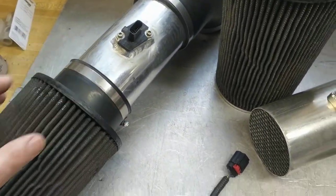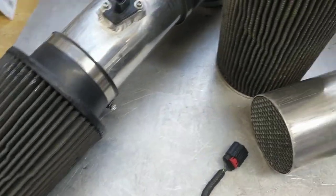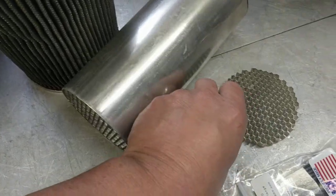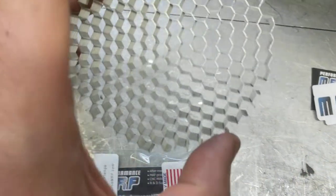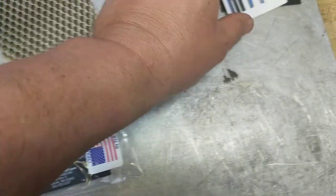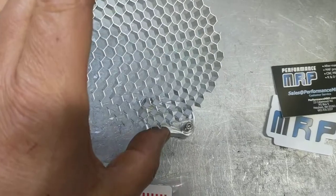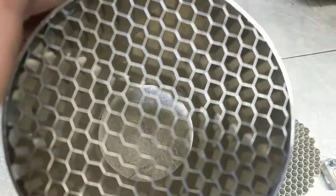Like I said before, I'm just running speed density on it now. But one thing I ran across with the slot meter — I had a boom tube with a bell mouth on the front that went out through the headlight hole, and it always acted funny, it didn't run right. I didn't know why, and one of the guys on a forum said you need to have an air straightener before the mass air meter. So I got to looking and found out that the same guys on eBay that sell this mount also sell an air straightener.